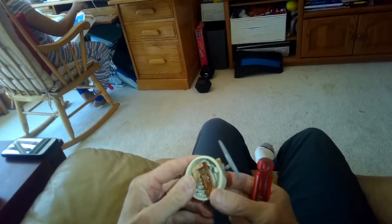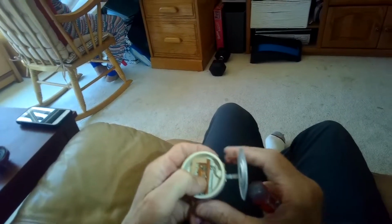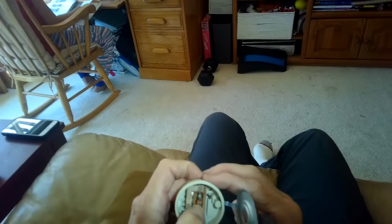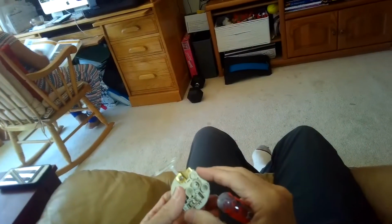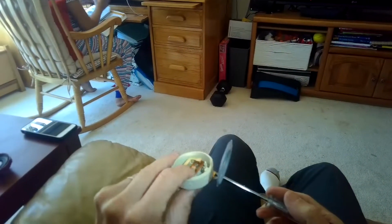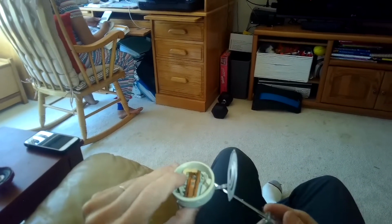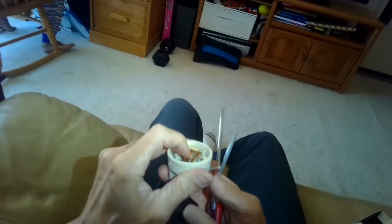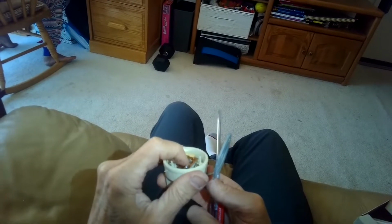So when the pressure comes up in there, it's going to push in on this plate, and it's going to click, but it's going to take a certain amount of pressure to do that. It looks like, though, you may be able to manipulate that with this screw here. The other screw allows this plate to go down lower, so if you turn it counterclockwise, it lowers it, and I believe it'll take less pressure to close that gap.